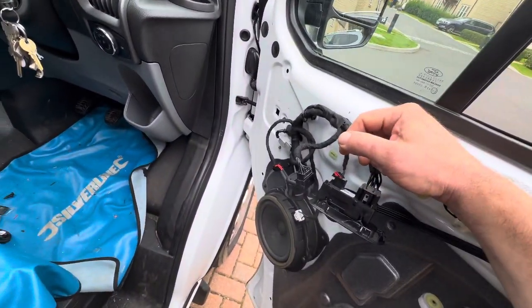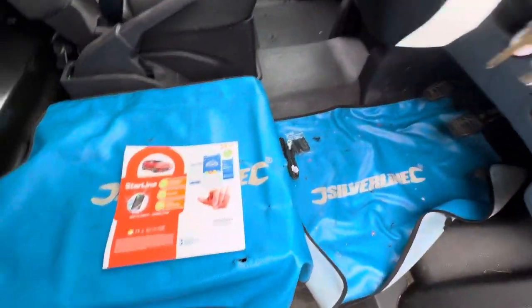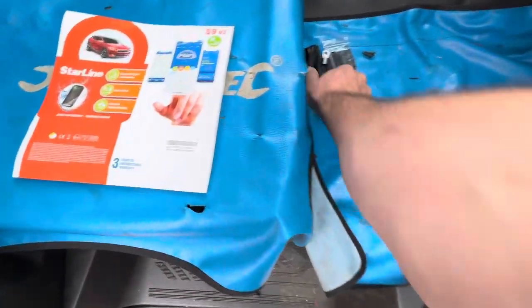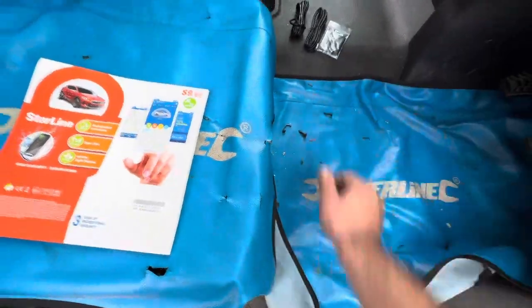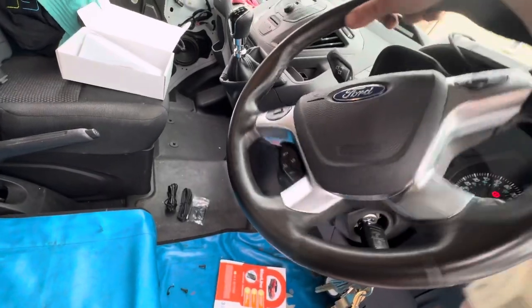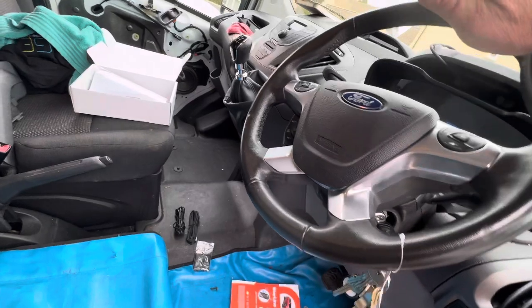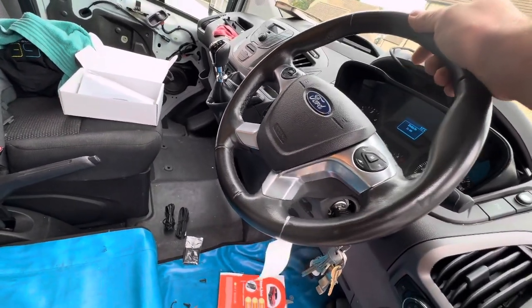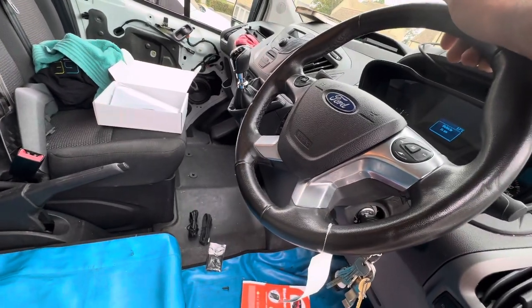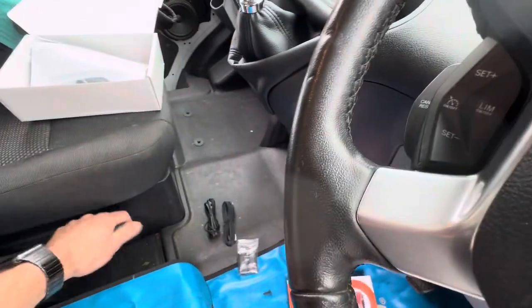Saves them flip-flopping all day. I'll show you how remote start works on a manual. He's had the seat tag because he's doing some work on his battery as well, so he's having quite a lot of work done. I'm just showing you the alarm before I leave today. Program neutral is what you need to do to remote start a manual vehicle, so it knows it's not in gear. It will never try and shunt forwards in first or reverse — it's totally fail safe. This is me simulating the journey.